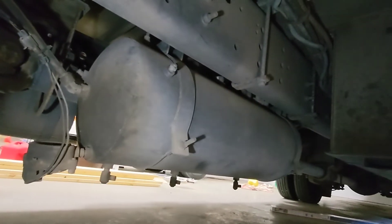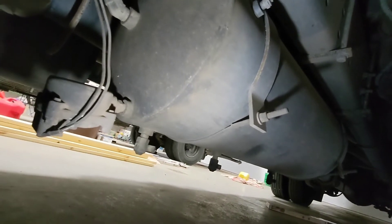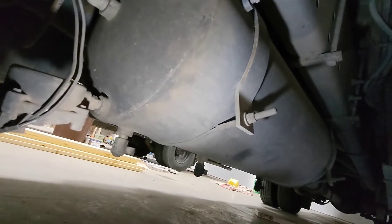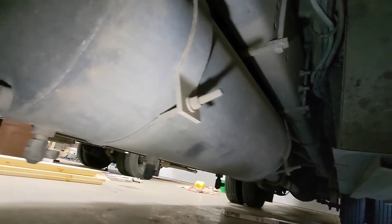What I'm going to do today is replace these manual drain valves with ones that have a short little leash. We'll run that up under the side of the bus and mount it somewhere where it's easy to get at. That way, every time I drive this bus, I don't need to crawl under here to drain the air tanks. If more people would do that, they would probably actually drain the air tanks as often as they're supposed to.